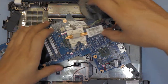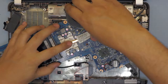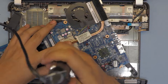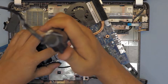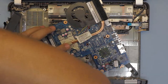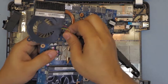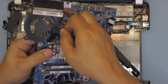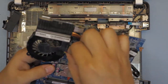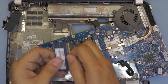You're going to put the heat sink back on and put all four screws in. Always make sure that you connect the fan cable back in — most people always forget it. Then go ahead and put the RAM back in.